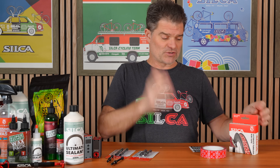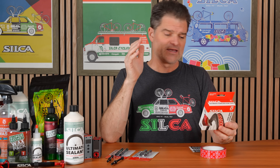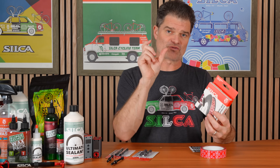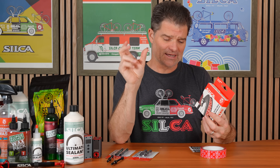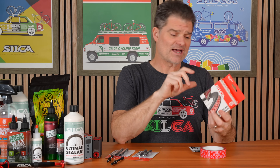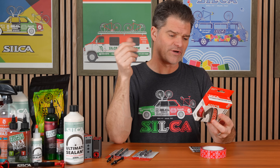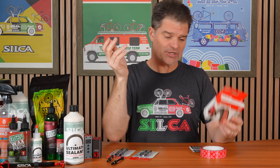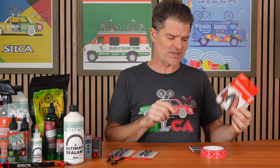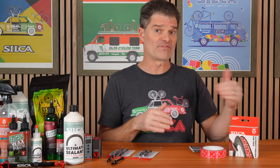So — a three physical ply plus adhesive tubeless tape comes in two sizes: 32 millimeter and 27 millimeter. The 27 is for inner bead widths up to 27 millimeter inner width hookless, which is about 25 millimeter hooked. The 32 is up to 32 millimeter hookless, which is about 30 in a hooked rim. It has a 120 PSI limitation for a single ply, which gives you some idea of the strength in this tape. I think most tapes over 100 PSI require you to use two wraps — we get above that with just one.